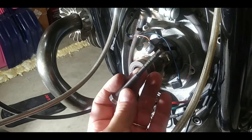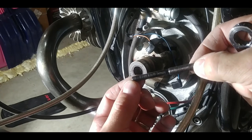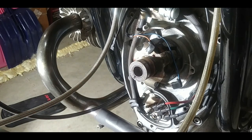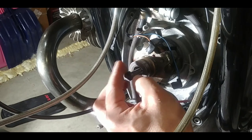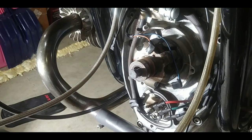So now I have my removal tool here. Made in Germany. If you want to know the part number — it's 13600N, made in June of 2000. This slides right in there and then you thread it on. You might want to put some lubrication on the threads, maybe just a drop of some sort of thin oil, because you don't want anything to seize while you are removing this rotor. The other tool that you might need is a nice big flathead screwdriver, and you will need that one to stop your flywheel from spinning so that you can actually take this loose.